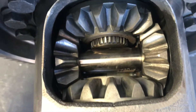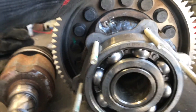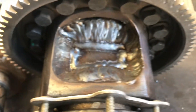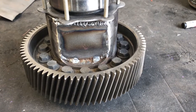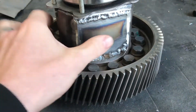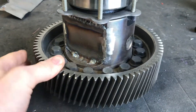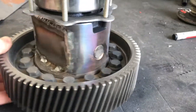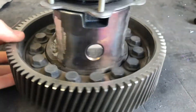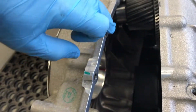That cover plate is there in case it were to explode on me through all the power and torque of the Tesla drive unit. I got a little bit carried away with the welder, but we don't want this thing breaking. That's one side done and another one to go. Welding is done and finished — I've put the protective plate over the front just in case it gives up, so it won't chuck bits of weld around the inside of the Tesla gearbox. I'm just going to clean off any weld spatter to make sure nothing breaks free once it's in the drive unit.